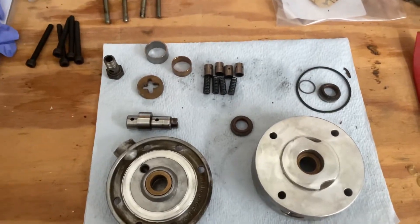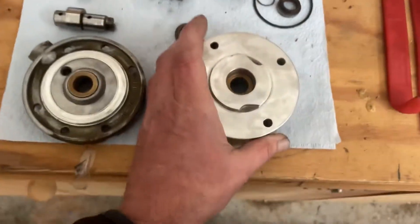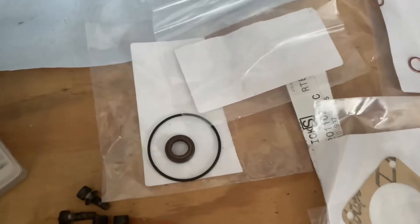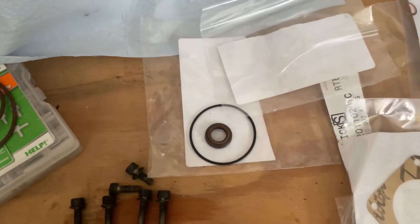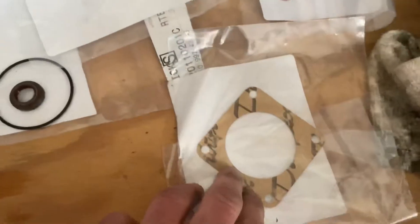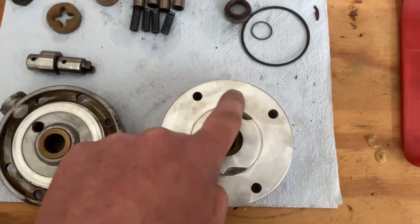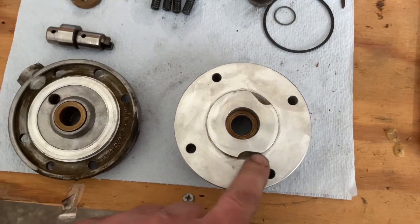Good morning. Yesterday I took out my hydraulic pump to do an overhaul because it started to leak, and I got an overhaul kit here for Mercedes-Benz. We got the outer gasket which is this one here, and as you can see the thing is completely flattened — that was round at one point. And this is my leaking front seal which I took out already. It was leaking into this paper gasket; what happens is the front seal starts to leak and then the paper gasket gets soaked up with hydraulic fluid, causing the gasket to harden and become very difficult to get off.